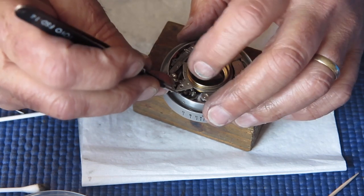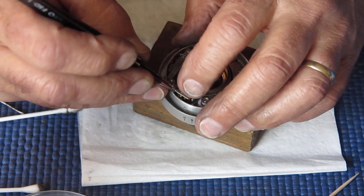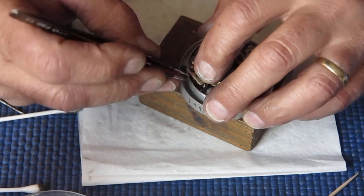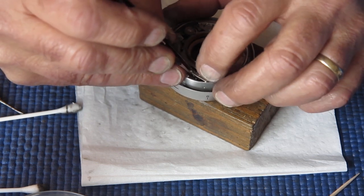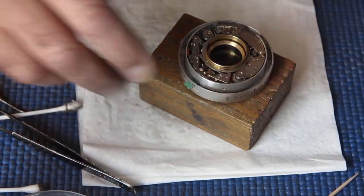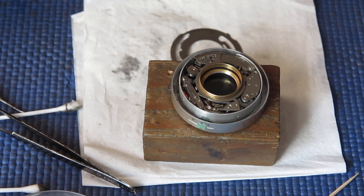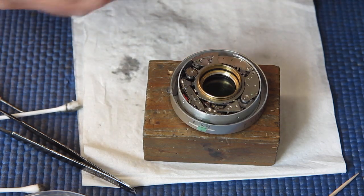Now, we have one little piece here, which is the latch. It holds all this in place. It holds the shutter cocked after it's been cocked until it's released. And I need to get this on its post with its spring correctly positioned. That's it. The spring's up. You have to get the spring on the right side of its post. Otherwise there's no tension and the shutter will not stay properly latched until it's released at the required instant.